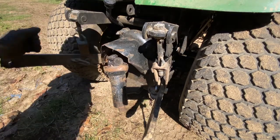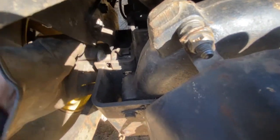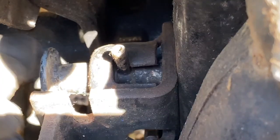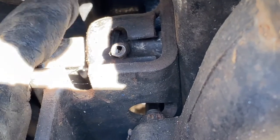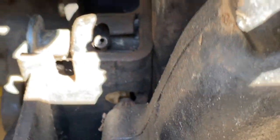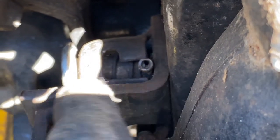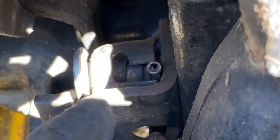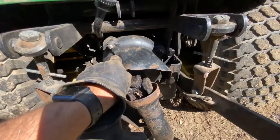She's locked in there. Let me just show you on top of all those pins. Hopefully you can see that pin right there — you can see what's caught. I'm going to tip it and if I wiggle it around it should lock in. I just only have one hand. But you can see now that that pin is to the right side of that slot and the head of it is right flush. So that pin is slid in place and this transfer case is now locked in place.